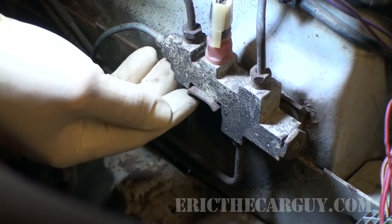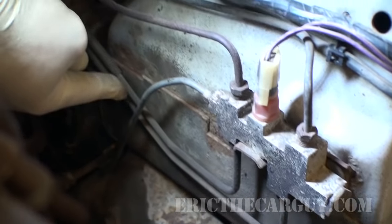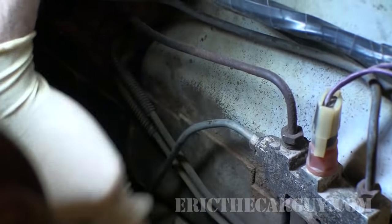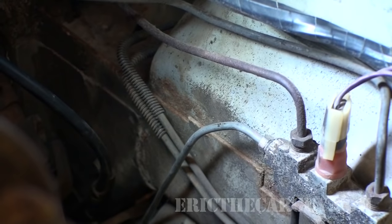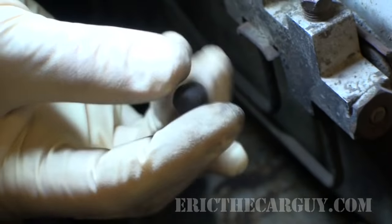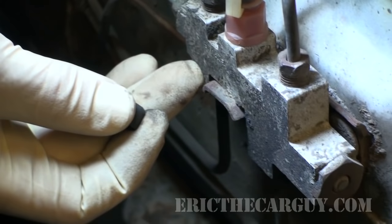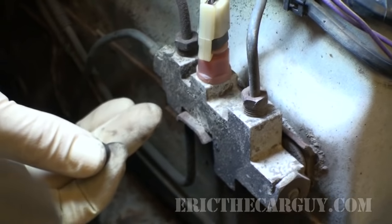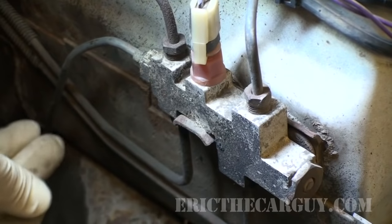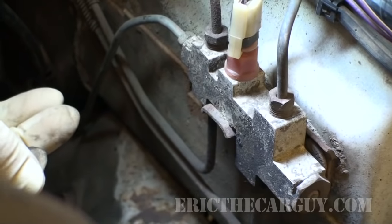I'm going to remove the brake line first. I'll take this out of here and I might have to deal with the other brake line, but I'm going to try to minimize brake fluid loss because I don't want to bleed out my master cylinder. I'm going to use a cap for a bleeder valve — I think I can shove this in while I work so as not to bleed out the master. Over at the wheel, I'm going to crimp off the brake hose so we don't bleed everything out of the caliper. If the master runs dry, we'll have to bleed all the wheels instead of just the one we're working on.